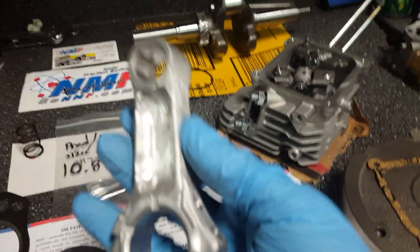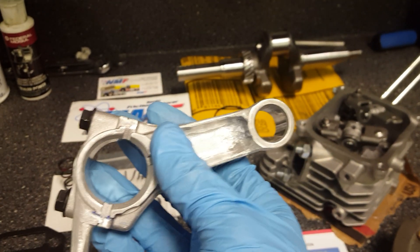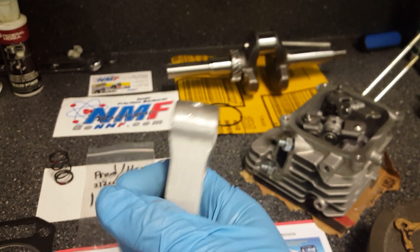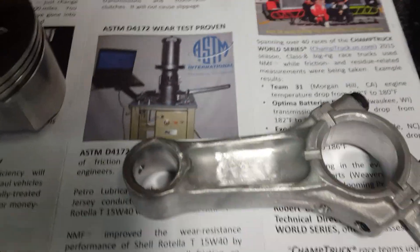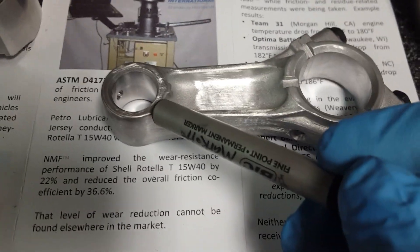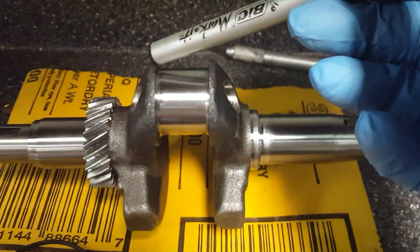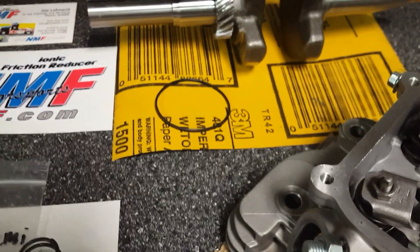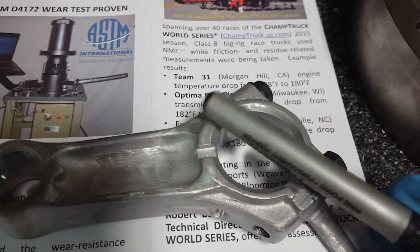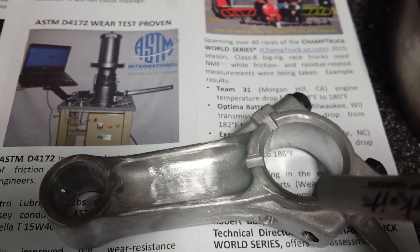To gain a little bit of horsepower, I took the stock connecting rod. If you ever take one apart, there are four little pins on there from the mold — I took all those pins out, ground it smooth, and took all the casting channels off both sides. On most connecting rods that area is nice and smooth, but this was all rough cast aluminum. I took some 1500-grit sandpaper, laid it on concrete, and rubbed the rod flat against it to smooth up that edge.